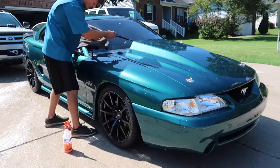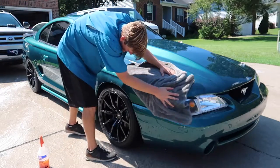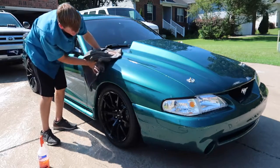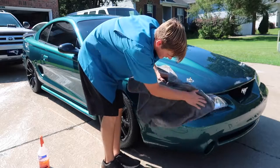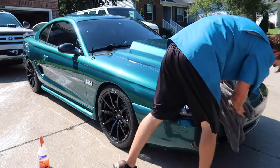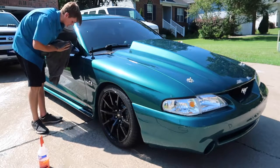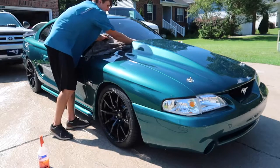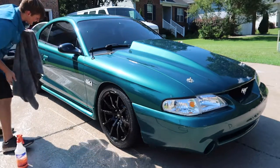The easiest time to scratch your car is during the drying process, because at all other times — like when you're waxing it you have wax as lubrication, when you're washing it you've got soap as lubrication — but when it comes time to drying, you just have your drying towel, water, and the car. There isn't too much lubrication going on. I like using Beadmaker because it adds lubrication to the drying towel so you're less likely to scratch it, especially if there's still some dirt left over from the wash, which is really common. In this scenario I'm using Beadmaker because I already have some on the car — it's just topping it off and replacing what was removed during the wash. I never spray it directly on the car because it'll spot weirdly if you take a millisecond too long to start wiping. So I just put a few squirts in the towel and work a panel or two.